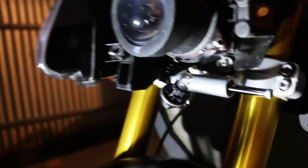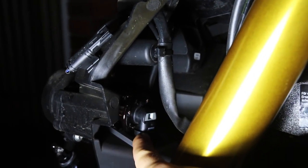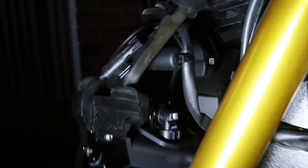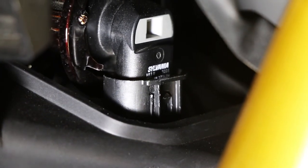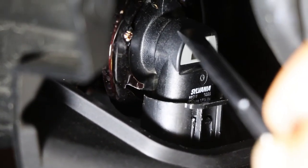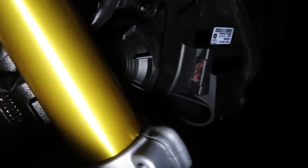The shit of a thing is when we have to start getting in behind. In behind here we've got our high beam. Now this twists to the left — the whole piece rotates. First, obviously you've got to undo this plug — it takes a little bit of fiddling. You've got to get this screwdriver in under here and pull this lever out. You can see that little clip in there. Once you've pulled this clip off, you move that down and rotate this full housing to the left, and then your bulb and everything will come out from there.